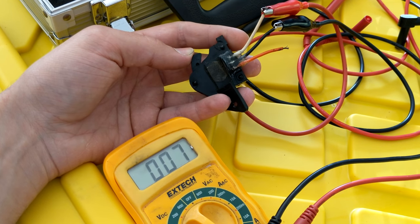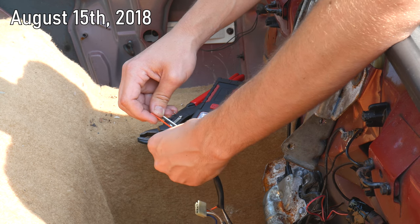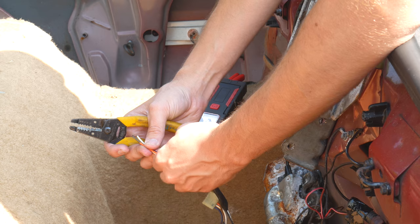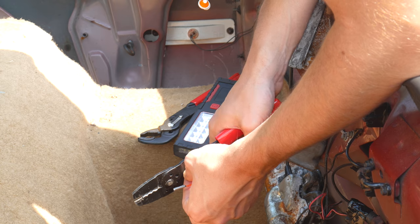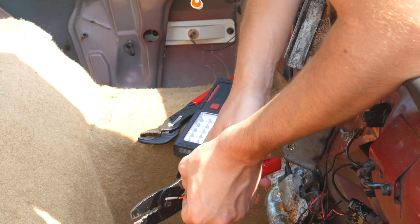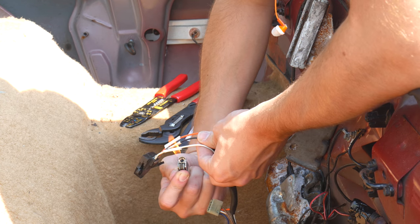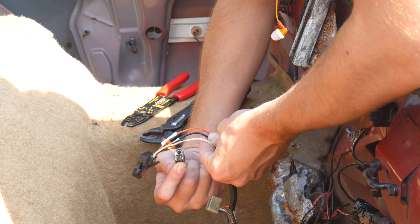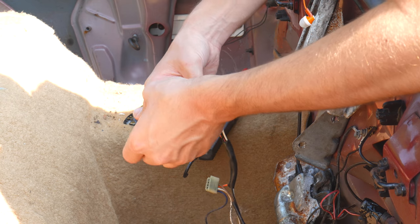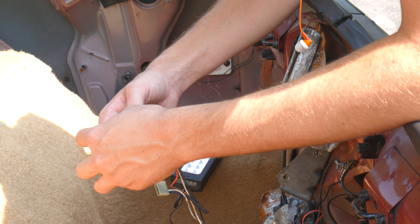Once the epoxy cured, we repeated the same multimeter test - we can now clip the leads onto our little pigtails. These two close when the switch is actuated, and the connection between these two opens. We also tested the other switch we repaired in the same way and it appeared to be functioning correctly. So it's time to wire things back up and see if we can get the hatch to work. We'll start with the more straightforward task - reconnecting the three wires for the latch switch. We'll strip off a bit of insulation, slide on a piece of heat shrink, and use an uninsulated butt crimp to connect the body harness wires to the pigtail. It's worth noting that applying an open flame is not a good technique for heat shrink tubing, but as long as you're careful not to burn it and it's still flexible at the end, it should be fine.